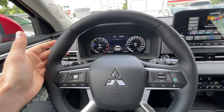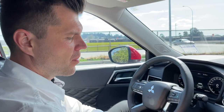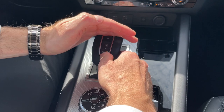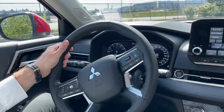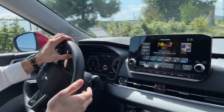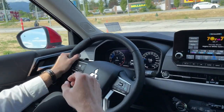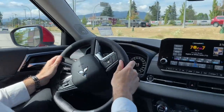Now let's take it out for a test drive to see how the practical application looks. Let's check out the first way — permanently engaging manual mode. Once we're in drive, we pull the lever one more time. It's kind of hard to see in the sun, but we can see the M — the manual indicator — lights up, and here on the panel we have number one, gear number one. Now we're driving and it's always going to stay in that first gear unless we shift it up. RPMs are going up and the transmission just stays put.